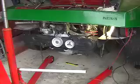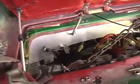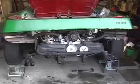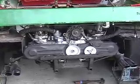As you can see, it's quite a compact little unit and it fits in very nicely. I've made an aluminium bulkhead plate to tidy it up and also cut down some of the noise that goes into the passenger compartment. The engine's ready to be pushed onto the splines now. I've made up a rear engine mount bracket which bolts to the main chassis.